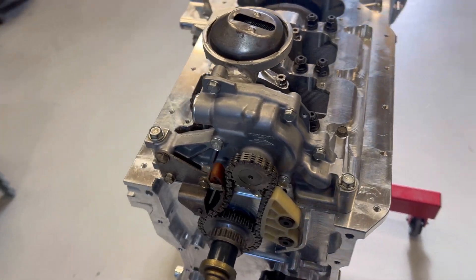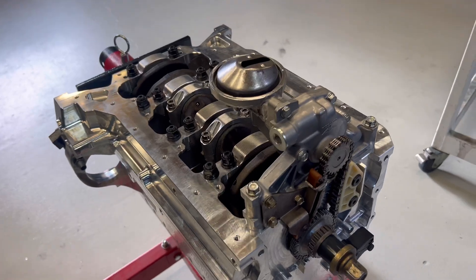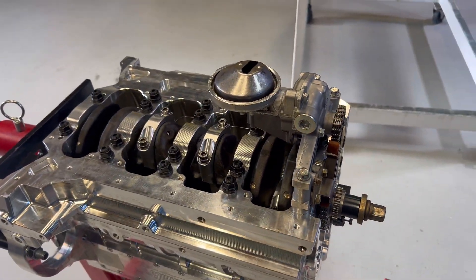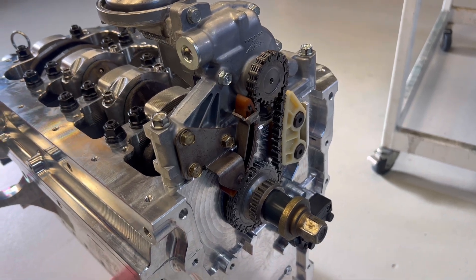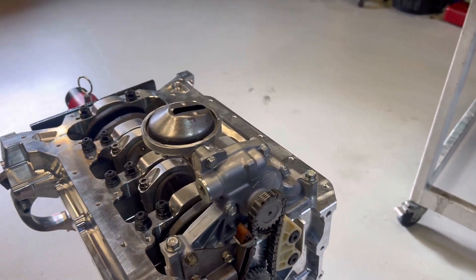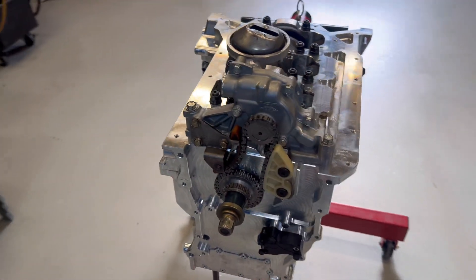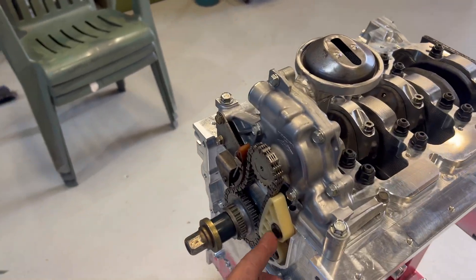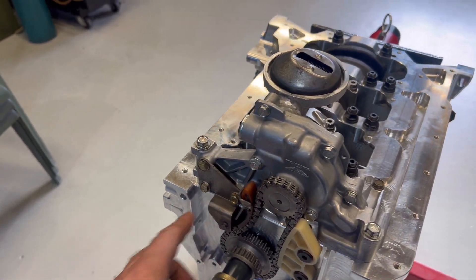All the OEM Honda pump goes on because they are a great unit — they're good for what we're doing. Obviously you can't beat a dry sump, I'm not going to argue there. But for drag racing and a little bit of street stuff, this seems to be all right with our oil pressure. I've just had to drill and tap these holes just a little bit further — they won't tap the whole way down. I've had to shorten the OEM bolts only by a few mil each to make them reusable, but apart from that all the provisions are there for the guide and the tension built into the pump.